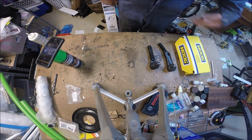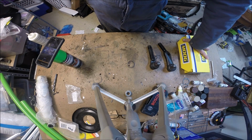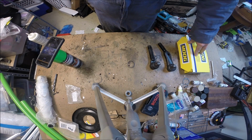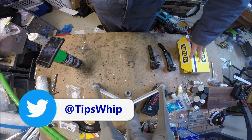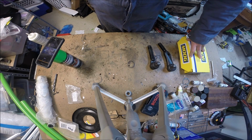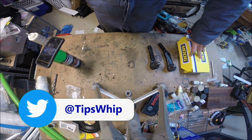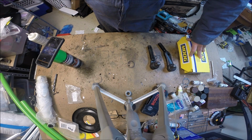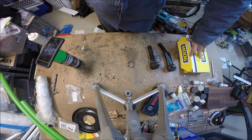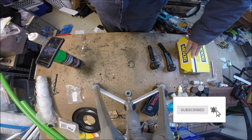When I first got my Jeep and started working on it, I bought a set from Rugged Ridge, their heavy-duty steering, which is quite a bit more beefy. The problem there is that you need wheels that don't have a lot of backspace. And I'm still running my factory wheels, which have like 4.5, 4.75 inches of backspace, somewhere around there. So it wouldn't fit. When I turned hard to the left, the passenger side wheel was basically scraping up against the end of the actual tie rod that crosses from knuckle to knuckle. And it's basically crossover steering, which is great, but it just wouldn't fit.